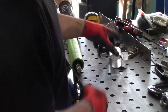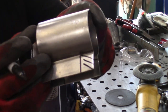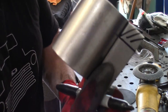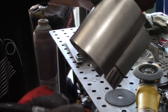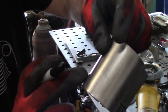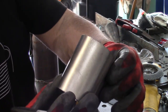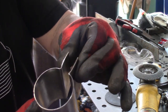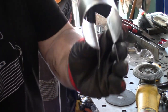So now we've got to drill it — put two bolts through that thing. I've got this marked where we're going to cut. This is going to poke through the firewall at a downward angle. This section will be visible inside the engine compartment. We'll weld around the outside and weld this right into place to hold that steering column so it doesn't go anywhere. The bottom section will clamp together, pinching the steering column into place where we want it. It's going to come out really good.